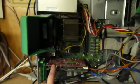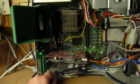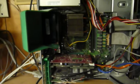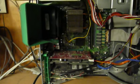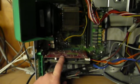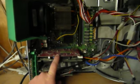It also began life with a fairly pedestrian NVIDIA graphics card, but one day that thing started to show garbage characters and had trouble shifting modes and doing things like that. I pulled it out. I found that the GPU was cooked even after replacing the capacitors. So I junked that board, ran to Best Buy because again I was in a hurry. I found this ATI Radeon, I believe this is a Radeon X1300 board.